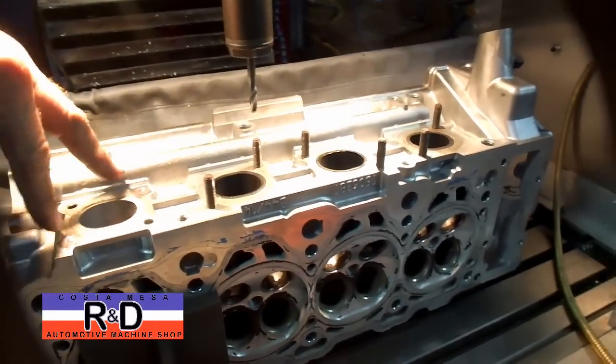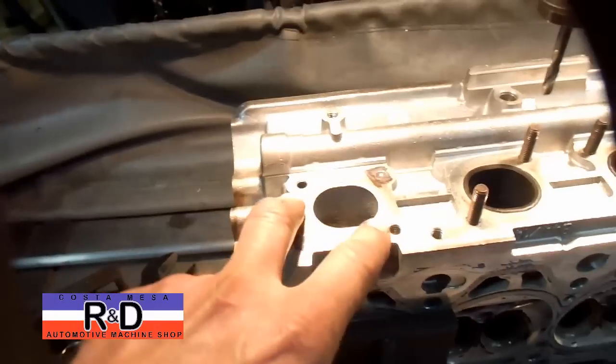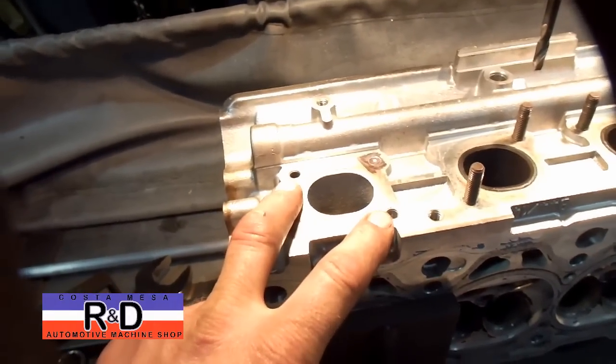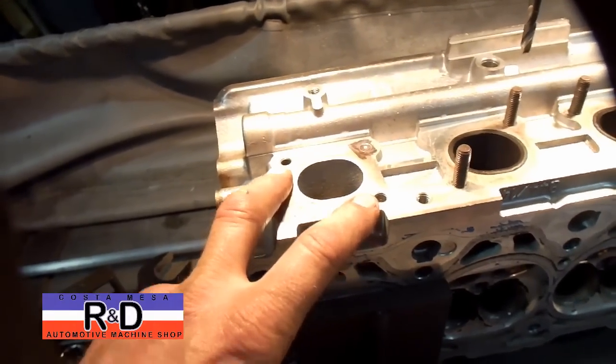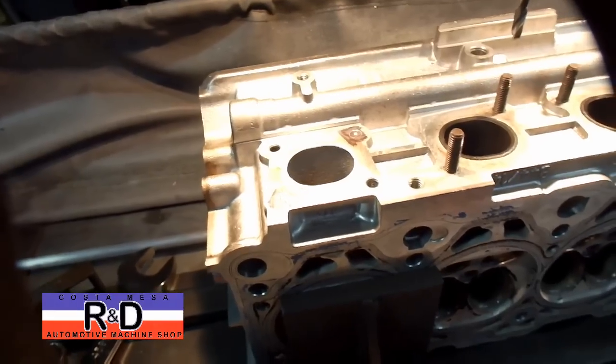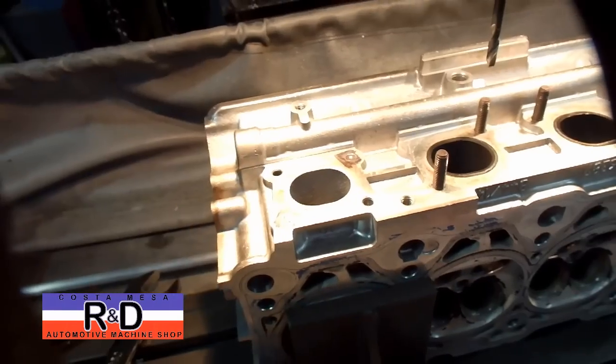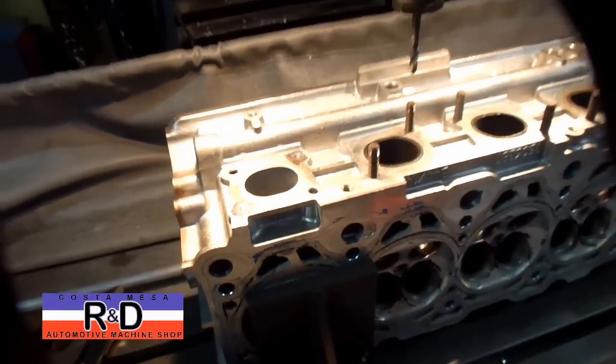But there's a variation where some of them bolt over here, and some of them bolt over here. We're going to do a modification on this so that this head can be used on any particular engine, because we'll add two more holes right here, which will make it a universal fit head. We're going to show you how that's done.